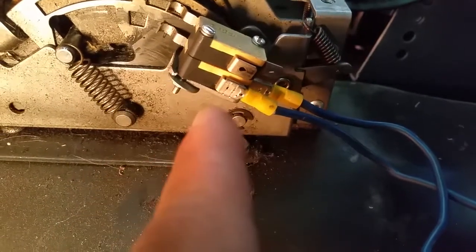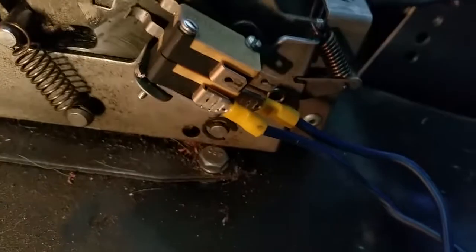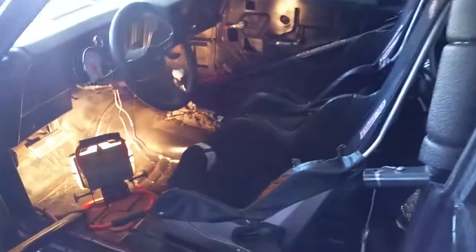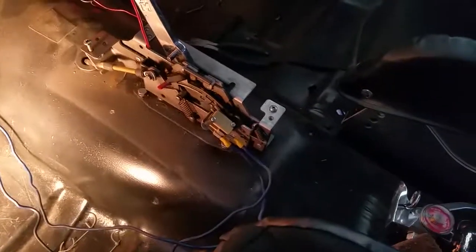The micro switch has one wire straight to the starter button, then the other wire straight to the starter wire — the S wire, the small wire on your starter solenoid. That's what it's called. And that's it, it's pretty easy. There you go.